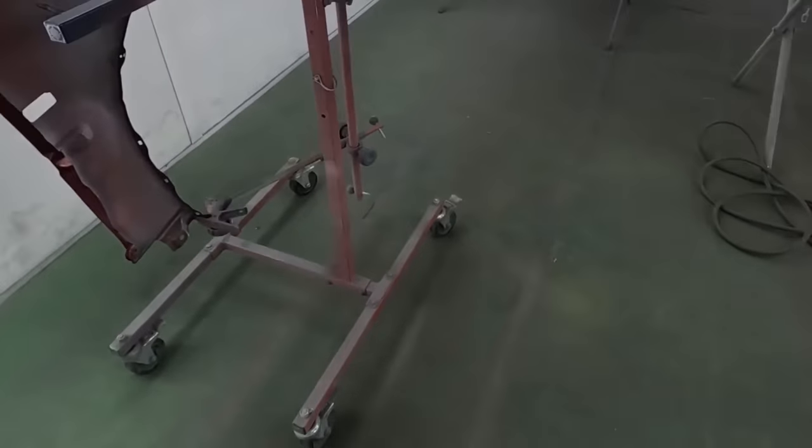Now on the flat panels, like the inside of the hood, those panels you can go a little bit wetter on because they're gonna take a little bit more material to flow out. You always wanna make sure when that hood is popped, if you're looking for that show car look, that it is completely flat as you can get it. Now, when you're applying a flat hood like this, make sure that you're moving just a little bit slower. On the jams and other areas, you can move a little bit faster, remembering to overlap at least 2 to 3 inches past the area in which you're painting.